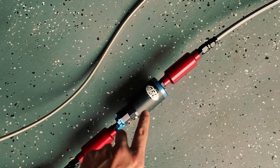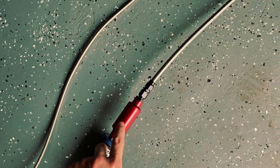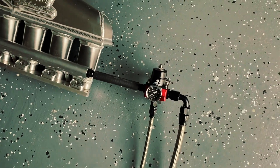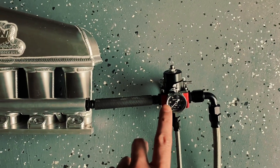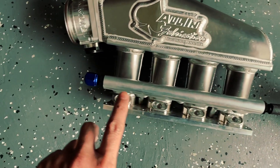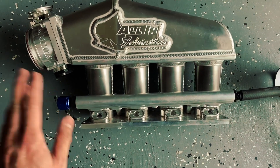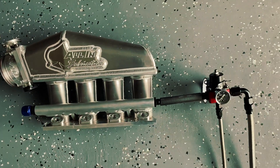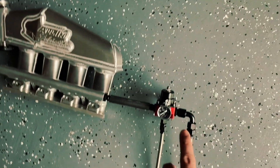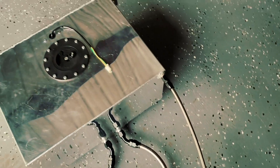From the fuel filter, go into the fuel pump. From the fuel pump, go into the fuel filter. From the fuel filter, the lines go out to your fuel pressure regulator. From the fuel pressure regulator, there's a line that goes into your fuel rail, and then the fuel rail goes all the way to the end. This will be blocked off — you won't need anything there. This is the first setup for the fuel system, and you have your return line that goes all the way back to your fuel tank.